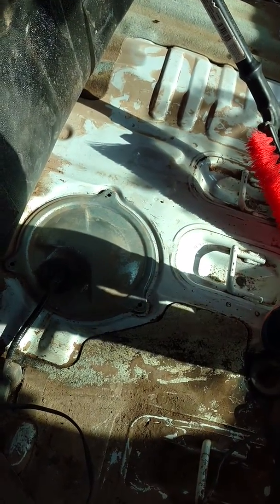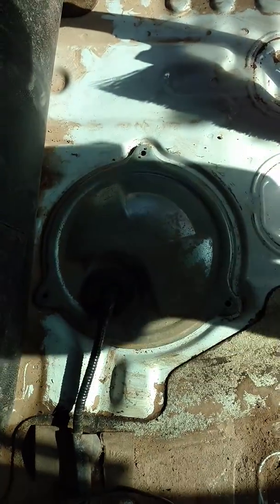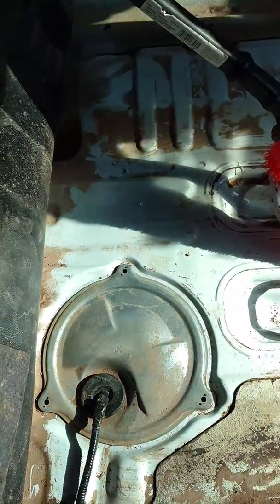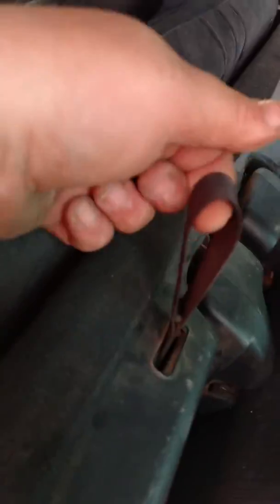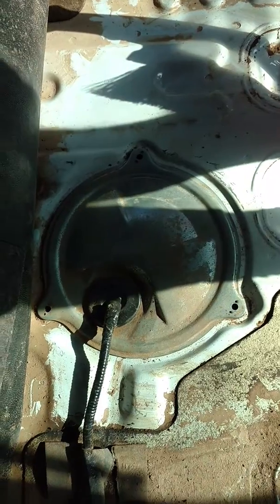For the 2002 to 2006 Honda CR-V, the fuel pump is right underneath the driver's side back seat. The seat is a 60/40 split, so you have to pull the seats all the way back, then pull on these little things right here and they'll flip forward. You have to tilt the seat all the way down, then lift up the carpeting — that's where the fuel pump is.